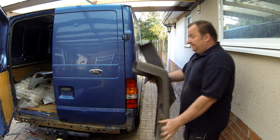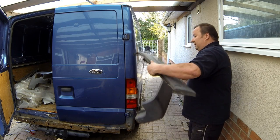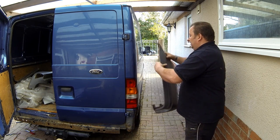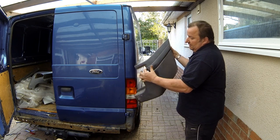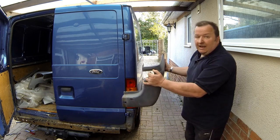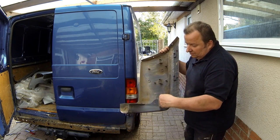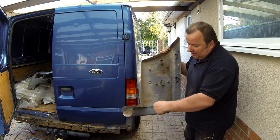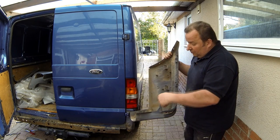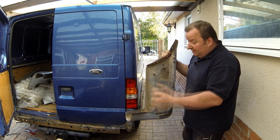This is the corner piece — it goes like that, and this bit goes like that. So that's how the bumper is fitted to the vehicle, and there's also a little black cover that goes just where that hinges, but that only pulls off. Basically you've got two of these clips or studs that have got a pin in the middle — you're supposed to pop the pin out, but these are aluminium. All I did was put a chisel or screwdriver behind and hit it with a hammer and broke off the top of the head. That was the easiest way.